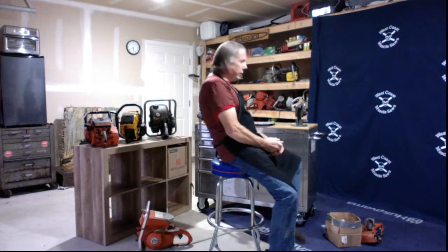I want to show you a couple things. I had another question on guys looking for mechanics that actually work on their saws to hot rod them. I'll give you some pointers on what you should look for. You want somebody that really knows what they're doing. A few questions you should ask, of course, is if they're decking the cylinders rather than just removing the gasket and put sealer in there.